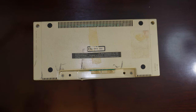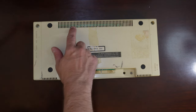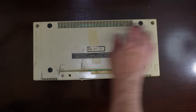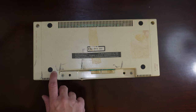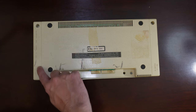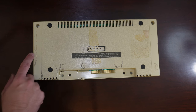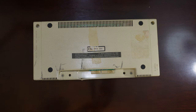Here's the bottom. I confess I have not cleaned this computer yet — it still needs to be refurbished. I've never even actually powered on the computer because I don't have a power supply. So this is one of my ongoing projects. We've got ventilation on the bottom, four rubber feet, and then screws to take it apart — I believe four total. Here you can clearly see the edge connector. The labels for each item are on the sides: cassette, RGB video, and UHF TV. And over here it says 19 volts AC for the power in.